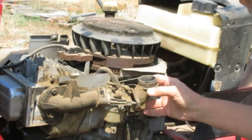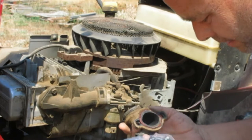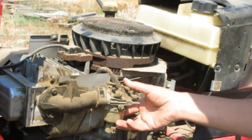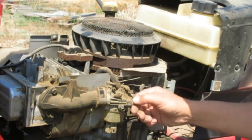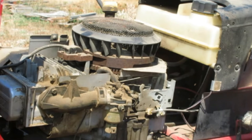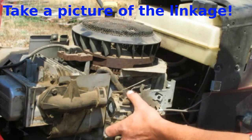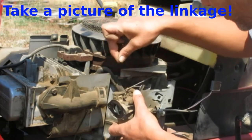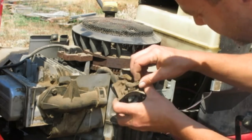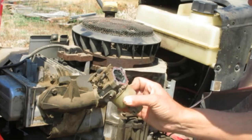It does not come with that gasket, but there's the intake tube and there's the carburetor itself. The studs have little nuts permanently on them — this one's already loose so we'll take that one off, and that one's tight. Got that one loose, go ahead and remove the spring, just on to removing the linkages. There you have it — the old carburetor. Gross.